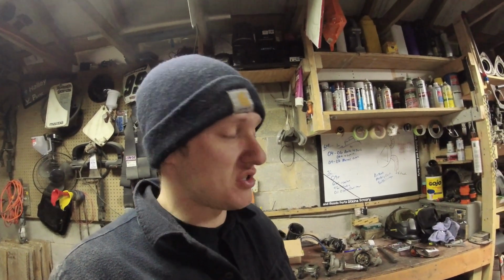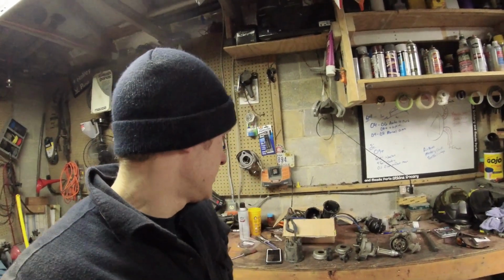Like I said, I don't really work with stock stuff, but we did the Holley Sniper install using the same stock ignition. That car I just set to like 12 to 15 degrees base timing, and it rips. It makes good power, starts every time. It's good to go. So that's my bit on vacuum advance.